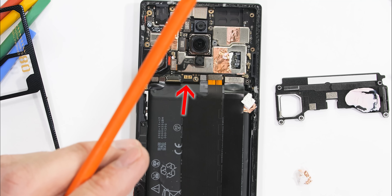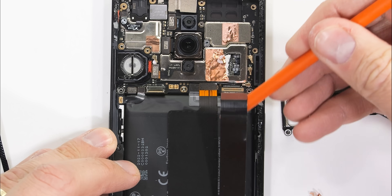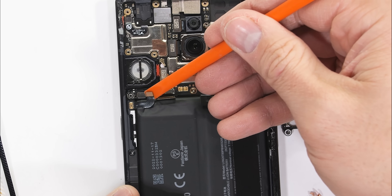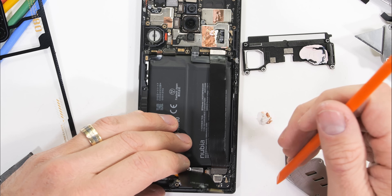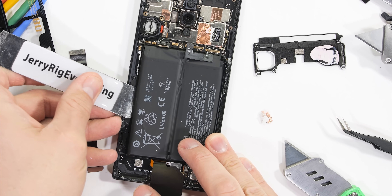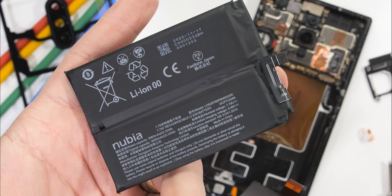It's interesting to see a completely unused port here on the motherboard — it looks like a battery connection. The actual battery connection in use is over to the right side of the silver Phillips head screw, and I can pop it off like a little Lego. The battery is dual cell, so I wonder if Nubia was thinking about giving each half of the battery its own plug at some point. The battery gets removed without too much fuss, which is nice. Each half is 3000 milliamp hours for a total of 6000.